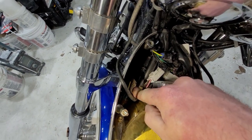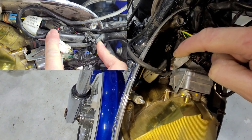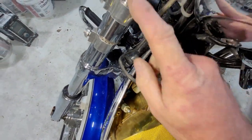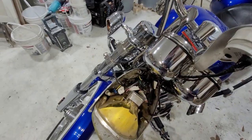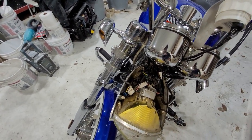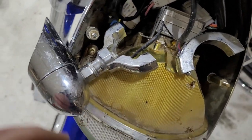For the right signal, it's going to be really tough to see, but the right signal is wired in reverse. The black wire comes in on that side and comes out on this side, and vice versa for the blue-red wire. So on a 2007 Vegas, the right front turn signal is reverse polarity. Heads up: do not wire it backwards.